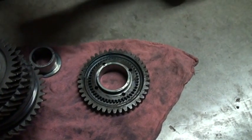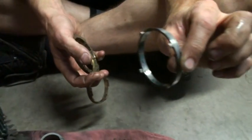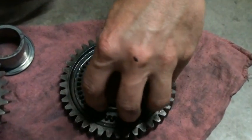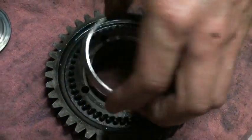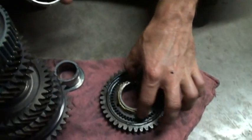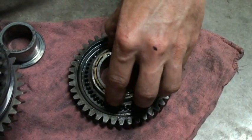It's got four holes in it, and those four holes match to four splines on this piece — this is called the cone synchro. You can see those match together. The way the synchro works is the inner synchro just sits right there, floats around the cone, and fits over it, locking into the gear.